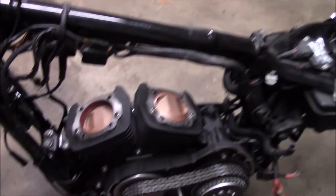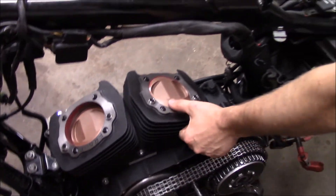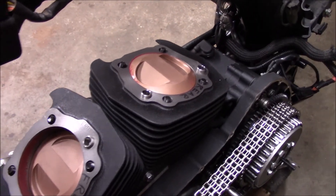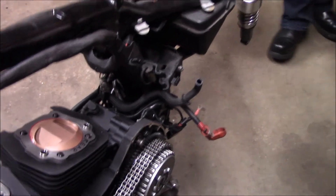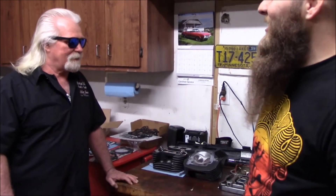This is actually my second set of gaskets. I have to adjust the base gasket to pull the cylinder up a little bit to increase the squish band — where the piston gets close to the cylinder head. Right now I've got about 20 thousandths clearance between the cylinder head and where it meets the piston, and I'm trying to get 30 to 38 thousandths. A little more compression, and you can't get any carbon crust up in there because you're not going to have buildup. I'll clean it all good all the time — that's my goal.